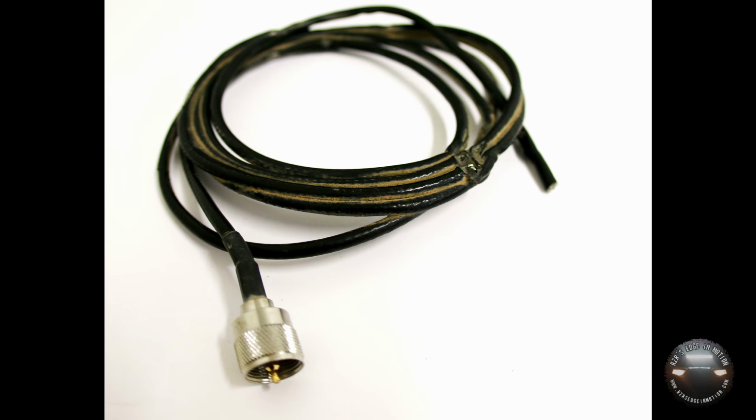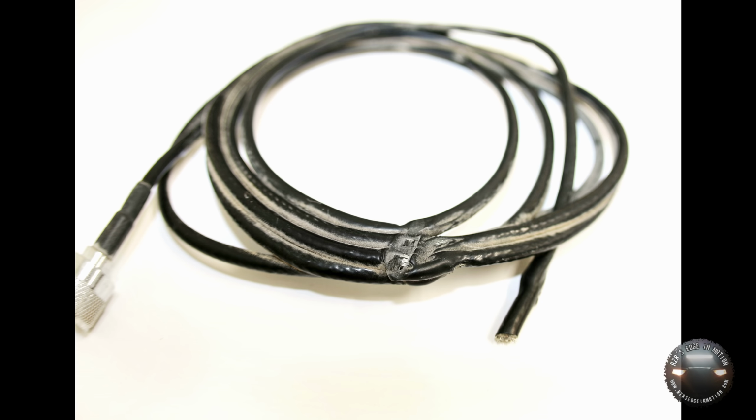Now in this picture, what you're looking at is a vehicle that was at King of the Hammers just a few weeks ago. It pulled up to the Rugged booth, said they were having trouble with their antenna, or their radio, and the techs went over to take a look at it, and sure enough there was a coiled up radio antenna that had been zip tied, and right where it was zip tied together you can see that the cable actually melted. The cable being coiled like this actually created a coil, and with the antenna picking up so many waves coming from all the other radios plus every single wave there is in the atmosphere, it generated enough heat to melt that cable, and that could have easily caused a fire and caught that vehicle on fire. So luckily it was caught before that happened.